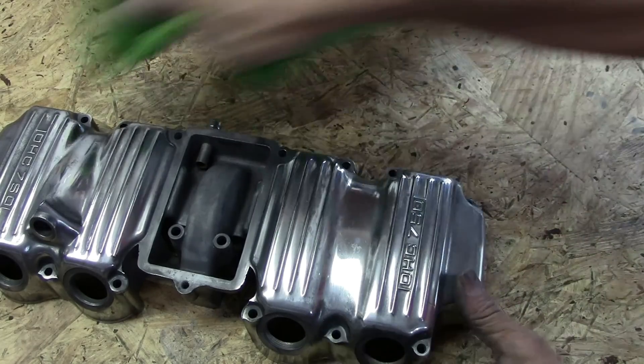That is a valve cover ready to put back on the engine. Now that we're done, what do we do with the leftover sodium hydroxide? Well, we just pour it down the drain because it's drain cleaner. If you've got a drain in the house that's running a little bit slow, take advantage of this and pour it down there, let it sit for a while, and give it a good rinse afterwards. Pour it down the toilet if you want — it's okay. It's just lye. By the time it gets diluted in the sewer system or in your septic tank, it'll be just fine. Just dump it out down the drain, don't dump it outside somewhere — some animal might walk through it. It's caustic. If you get it on your fingers it feels kind of slippery, which means it's taking the fats out of your skin.